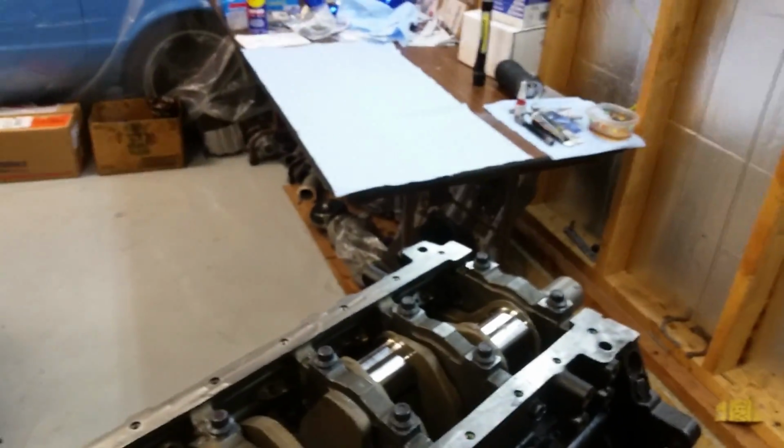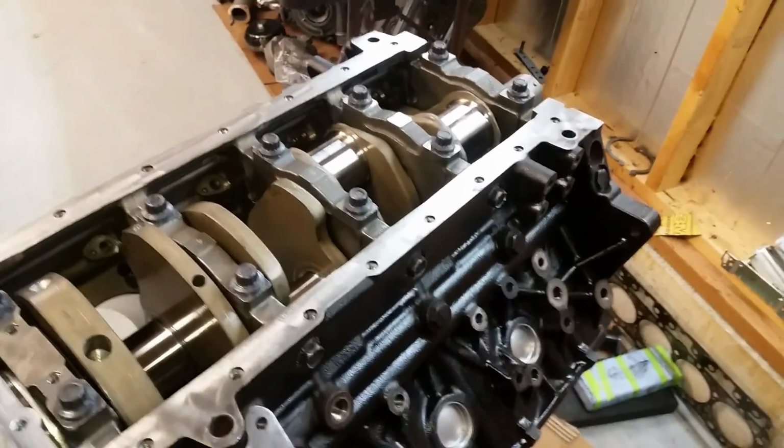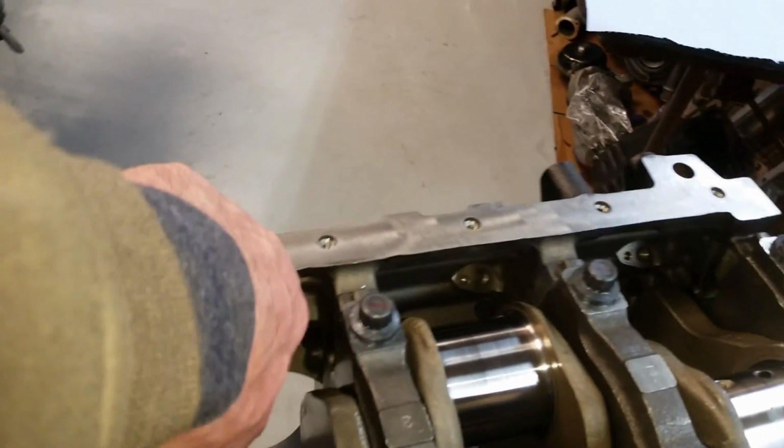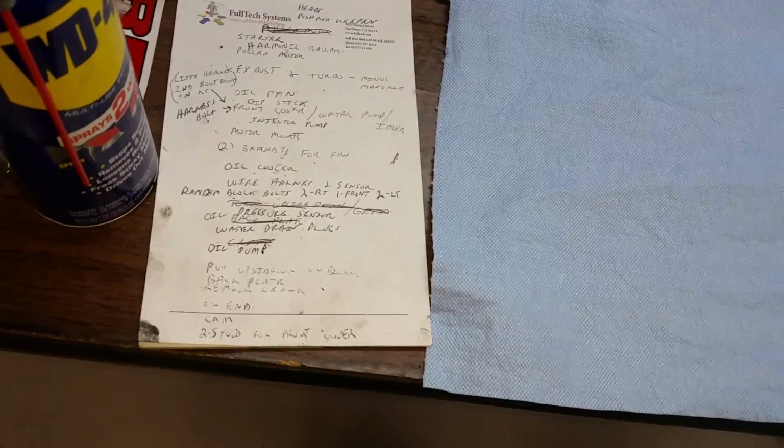Okay, good. Now, next thing I gotta do is break out all the connecting rods, pistons, wrist pins, rings, check the end gaps in the rings, and line everything up on my bench over here. And get ready to do that. One thing I don't want to forget is to put these squirters back in here, squirting the bottom of the pistons, which I won't. I got a list. As I took it apart, I wrote things down. So I'm just kind of backwards in engineering. Pretty detailed stuff, you know, as far as what I took apart. Make sure I won't miss anything. And so far so good.